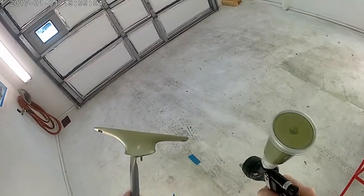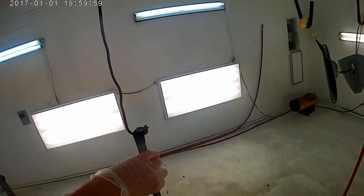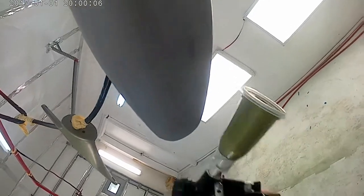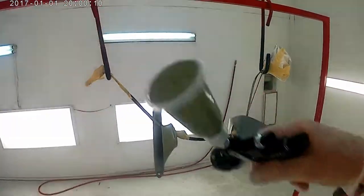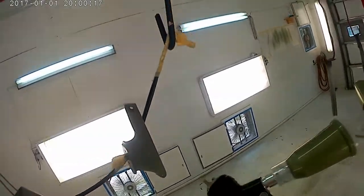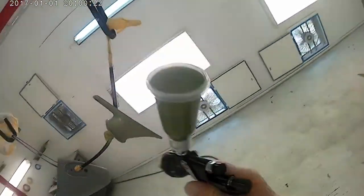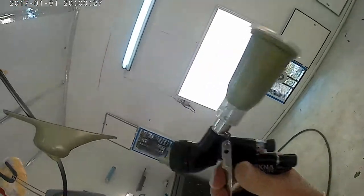Just getting the mirrors green. The base coat goes on not shiny at all — it shines a little bit if you put it on wet, and it has to dry in between coats. The only objective with the base coat is to just get the color on the parts. You're not trying to get any sort of shine. If you're trying to get shine, you're going to get runs. And if you're getting runs in base coat, then you really need to take a step back and learn how to paint.